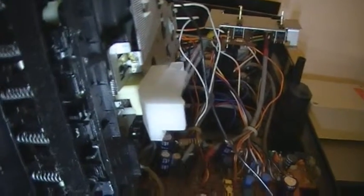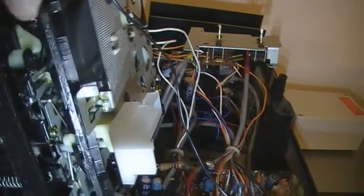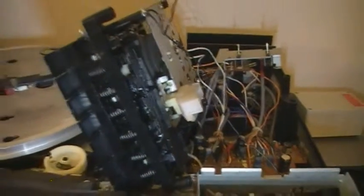Now what's happening is the play button is so worn — the latch on the play button is so worn that it won't latch into the interlock. The interlock is held with a spring, and it's very light — it could do with a heavier spring. So that's how we're going to fix it. I used to fix it with a rubber band, but I'm going to try and find a spring that I can put on to actually hold the interlock in place a lot better than it is. That's the plan.